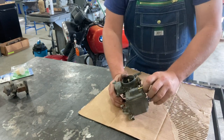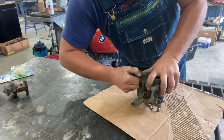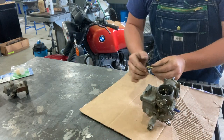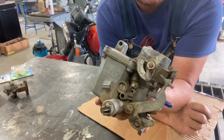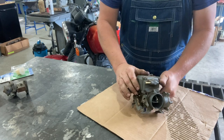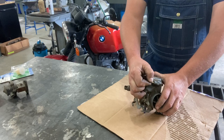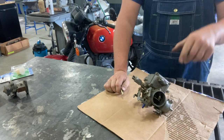Watch this — I'm going to pull on this, grab it... there we go. It took a little bit of strength but I was able to pop the inlet right out of this carburetor, and that is exactly what is happening on the vast majority of these fires. These get loose over time. I'm not bashing on the Brazilian carburetors — I haven't tested a Chinese one because I refuse to buy that stuff — but the Brazilian ones seem to be more prone to popping out than the original German ones, although the German ones will do it too; I've seen it happen.